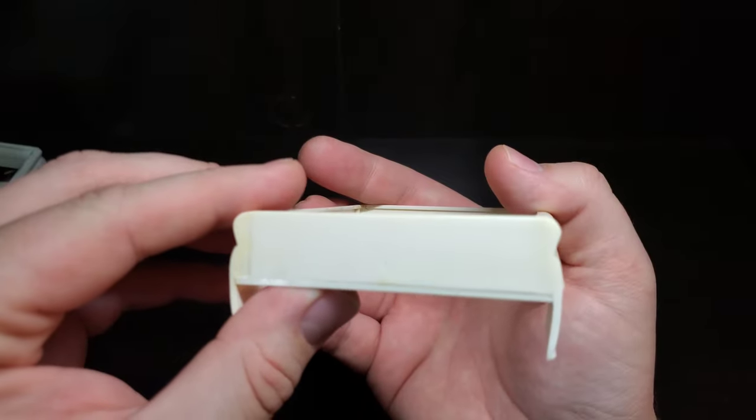We'll put some brown over the black and then rub it down, and all that grain will kind of show up through the top. I'll probably leave it in primer for Sean to decide what he wants to do — if he's got a better technique, by all means. I'll wood-grain texture mine up, chrome-strip it, but I'll probably have a tonneau cover so it might all be for naught. The beds are 90-degree surfaces so the color difference won't stand out too much. Looking around the body — just a nice smooth clean finish, everything blacked out, no bare plastic showing.